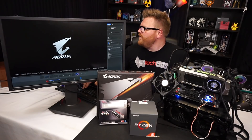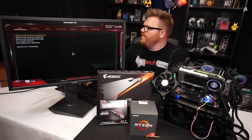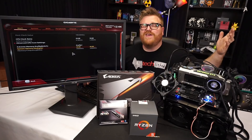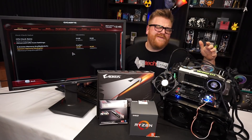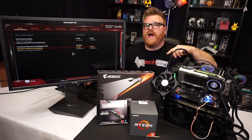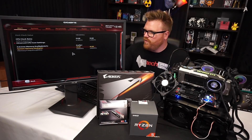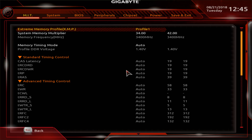Let's load up into the BIOS. Under Advanced Frequency Settings it looks very similar to my Aorus X470 Ultra — until you go in and find there's no BCLK adjustment, so no fine-tuning your overclock at all. The memory situation is also limited: I can usually push north of 3600 MHz on Ryzen on most boards. Even the Gigabyte ITX B350 accepted a 3600 MHz CL19 overclock, but this board tops out lower and 3400 MHz at CL19 isn't ideal.